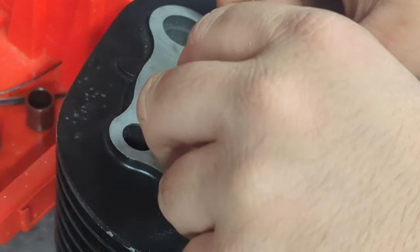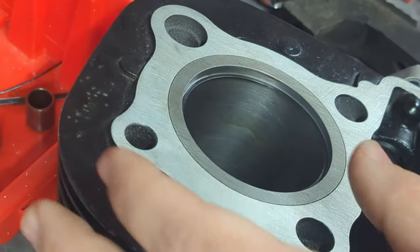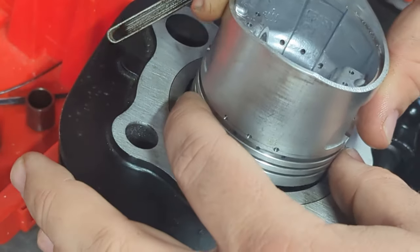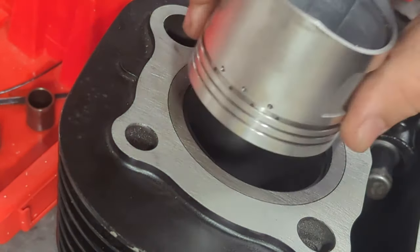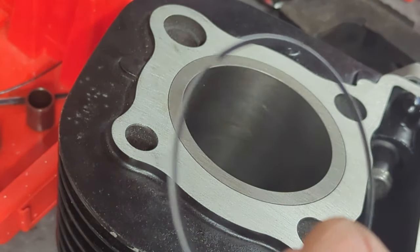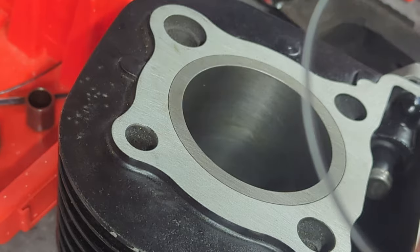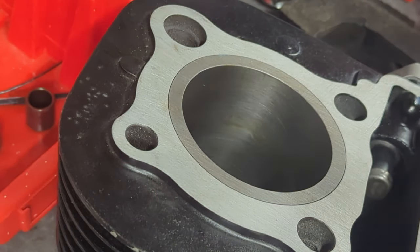Last thing is the oil rings. The oil rings are three parts: two rings and a concertina expander piece that goes in between them. They have different specs — 0.3 to 0.9mm — so it's a wider tolerance. At the moment there's next to zero gap on these, so I'll go sort those out. Both oil rings now have the same gap. These are more awkward because they're thin, so they don't stay where you put them and they cut much quicker — maybe do the oil rings first while you're being careful. Also take care to make sure you don't leave any burrs or sharp edges on the gap.